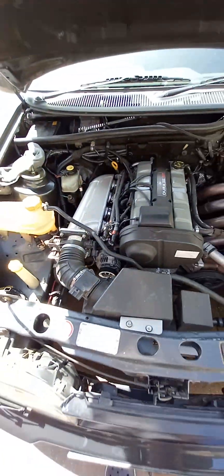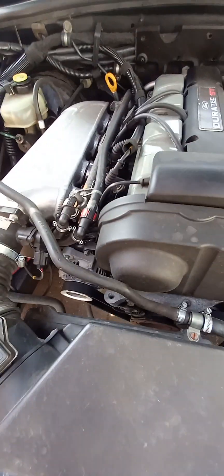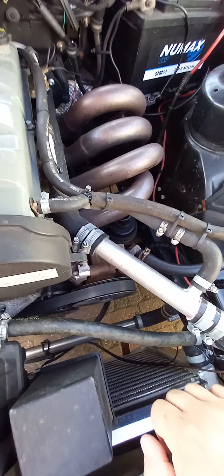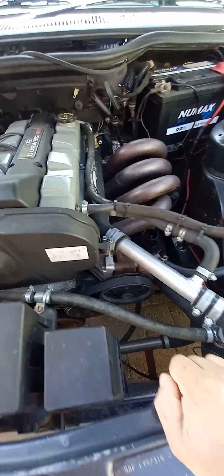Runs in the same Sierra state, just round the back. You've got a new auxiliary belt. The alternator is a 5-rib, the rest of them are 6 — so there's a rib missing here. That's not the belt shaved down, that's just because the alternator dictates that. But it fits up well on the bottom pulley, so that's all that matters there.